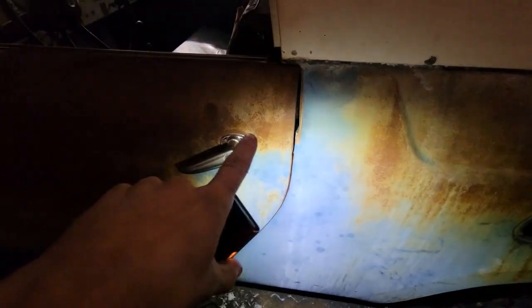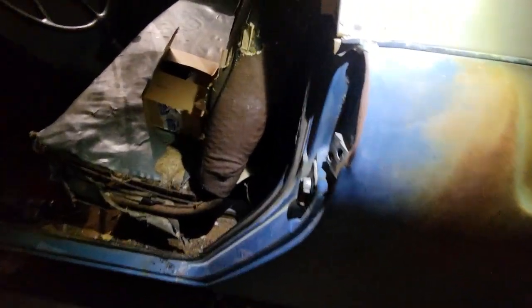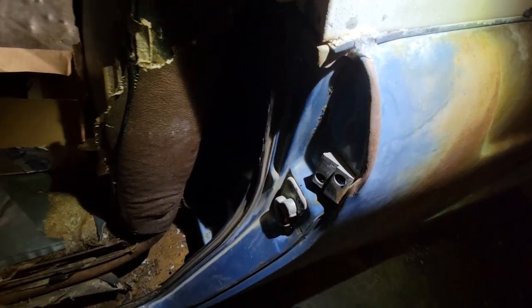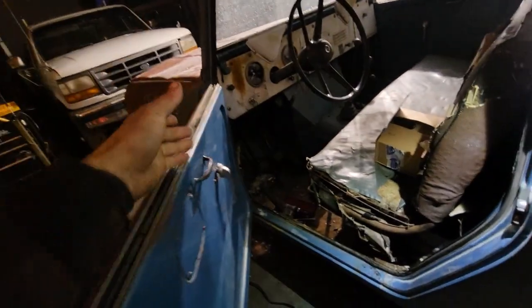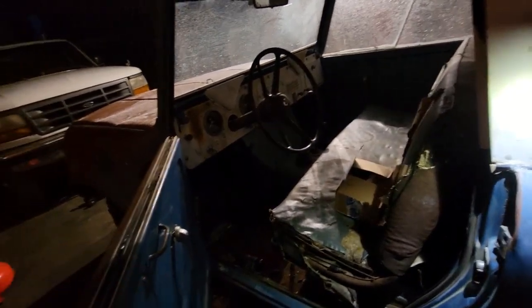With just a little bit of care she closed all the way - still not perfect but way better. I just had to take the angle grinder and kiss the back of the striker area a little bit to make the door close. Door closes good and tight now, even though it's not perfect. Next thing is to put the window track on and the single pane of glass I have. One of these days I'll have another pane of glass remade and I'll have all four pieces of door glass, but that's a long ways down the road.